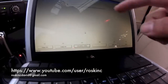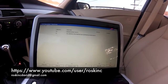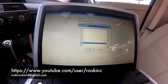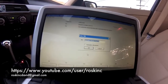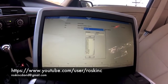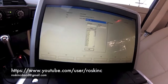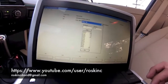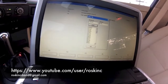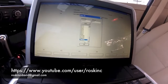It's going to load up. You're going to see it's going to have the VIN up here in the vehicle order that's already listed. You want to go F2, enter FA. Select E60 again, press OK. Your VIN should show up. Now this is the list of things that are added into your car — the vehicle order is already on there. Now we're going to add auxiliary, which is up here. Click there and it's going to be plus sign N-A-U-X. Press add and it's going to be added to the list right here. Then you press OK.